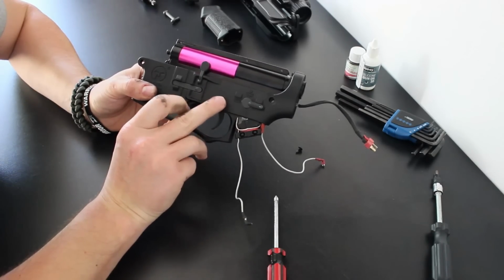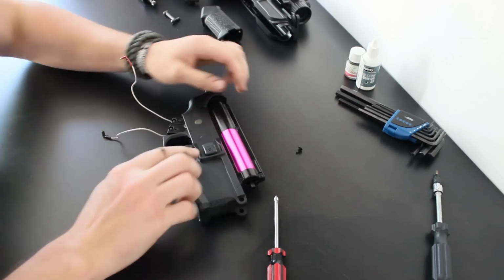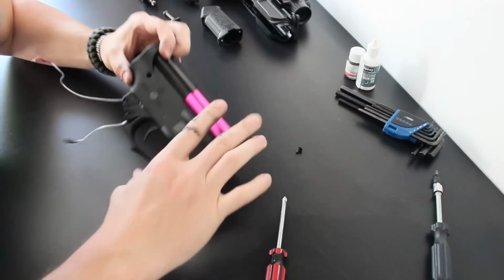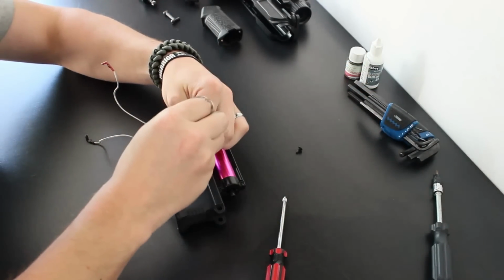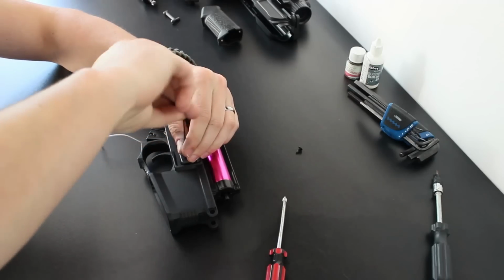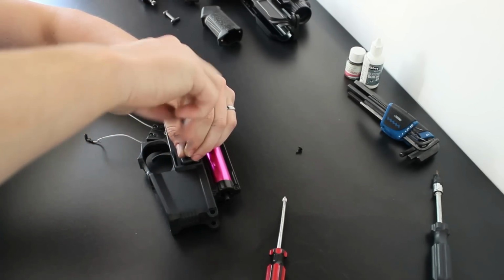They're pulling on their motor and it doesn't come out because of this reason. So flip this over. On the back here, you can see you've got your mag release with a very small Allen key in the middle. And what you're going to do is just get a 1.5mm Allen key, stick that in there, and just with a light turn, just heard a bit of snap there under pressure, spin that off.